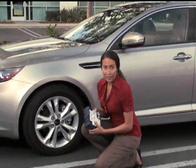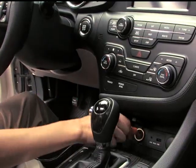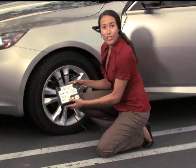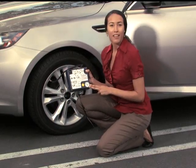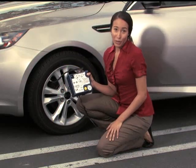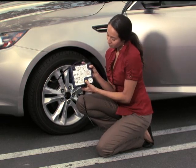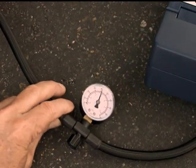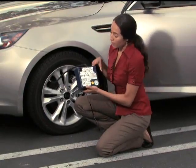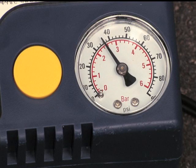Now take the kit's compressor back to the affected tire and hook up the compressor hose directly to the tire's valve stem. Reattach the power cable to the power outlet in the vehicle and turn the ignition on. Check the gauge to see if the tire has the proper PSI — you can find that information on the tire and loading label right inside the driver's door. On kits where the gauge is on the compressor itself, you can deflate the tire if pressure is a little high by pressing this button, or loosen the screw cap on the compressor hose on kits where the gauge is attached to the hose. If the pressure is too low, turn the compressor on to inflate the tire. Turn the compressor off when checking tire pressure for an accurate reading.